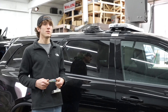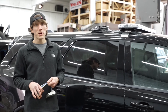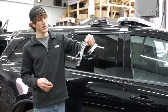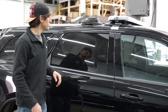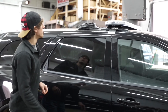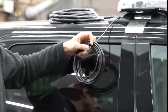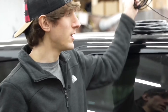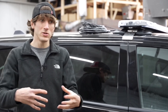From an installer standpoint, these WeCanX products also save you money on install time. We go from a wire harness that looks like this with 20 different wires for each function to a wire harness that has just three data wires that go from the light bar or light and run to the controller where everything is synced together.